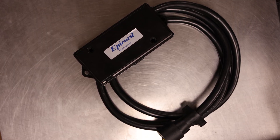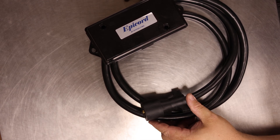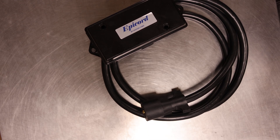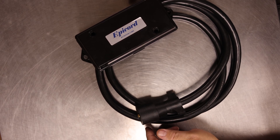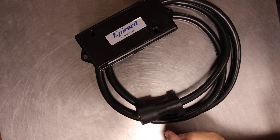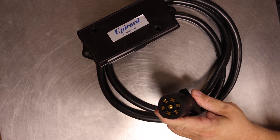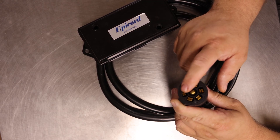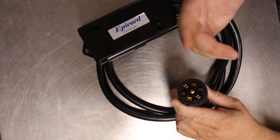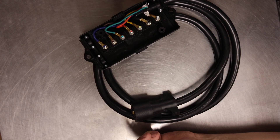Alright, so seven-way junction box with seven-way pigtail cord. Your standard seven-way is typically going to be what they call RV standard. There are some out there that are SAE standard, but for the most part we'll be going over RV standard power cord. I will leave a link in the description below to our blog post that goes over the difference between RV and SAE. Really the main difference is the color of the wiring. So between a SAE and RV, each point does the same function — they just have different color coding. So when you open up your seven-way junction box you're going to have your seven posts and they're going to be color coordinated.